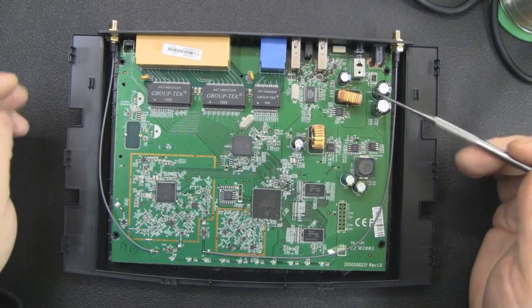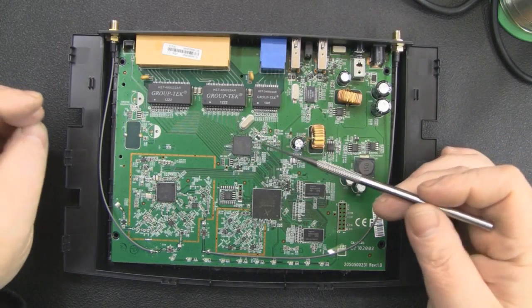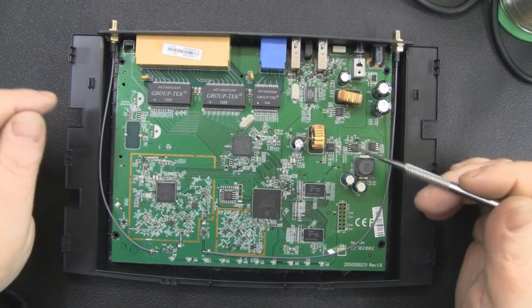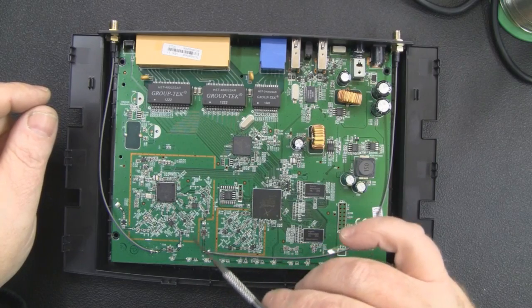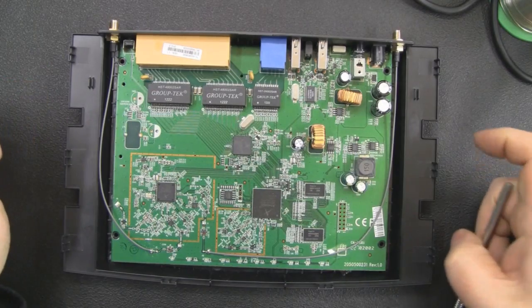There's no way that I can split the two signals coming from this chip here, like I did on the Linksys router that I've just modified. Both signals come down the same track and actually go up the coax themselves — there's no way to split them at all.